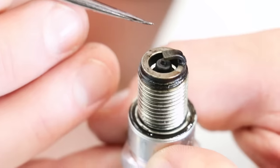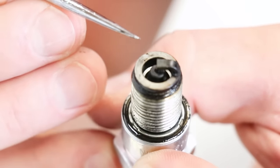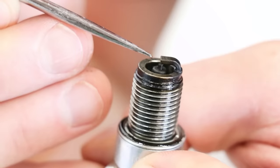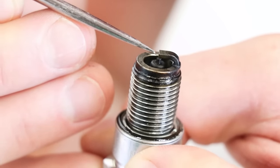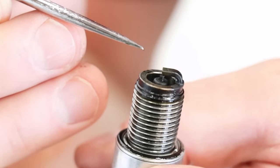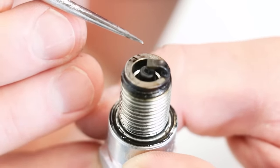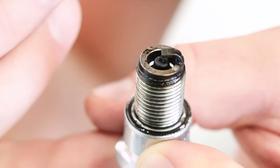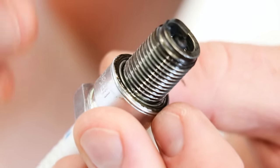What I'm going to look at now is ignition timing, and you can read that from the tip of the electrode. The lighter color should be less than half a millimeter from the tip. With this plug you can't really tell — I don't think I ran it long enough to get that lighter color to show up — but if the lighter color is more than half a millimeter from the tip, you'll need to retard the ignition timing.